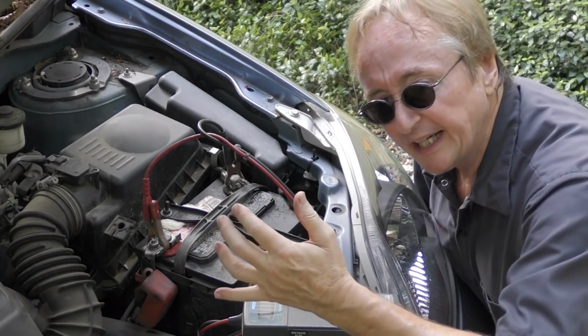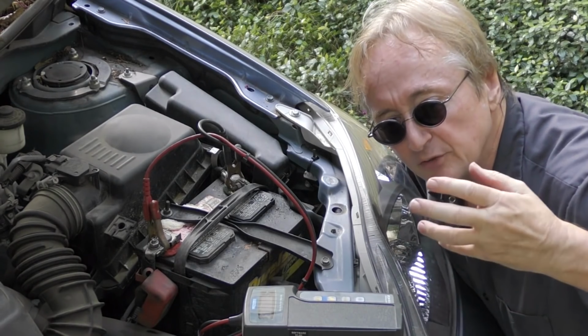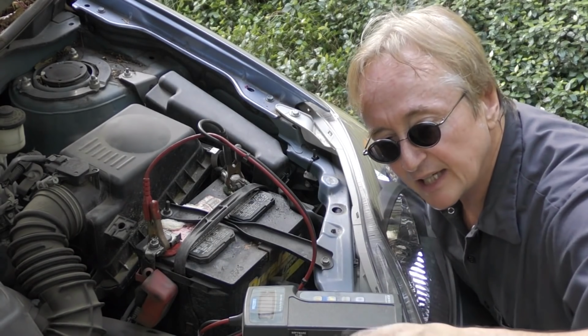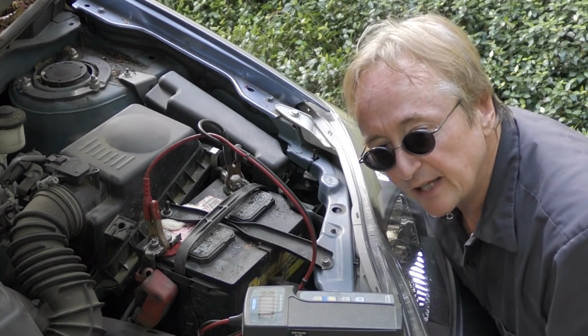If your battery is weak, or your alternator isn't charging correctly, and this test takes about 2 minutes, then when you turn the electric motor on to make the window go either up or down, they use a reasonable amount of power. If the battery's low or the alternator's weak, it'll often make the car idle a little weird, or the headlights dim at night, and it's really not the motor, it's the battery or alternator not charging right.